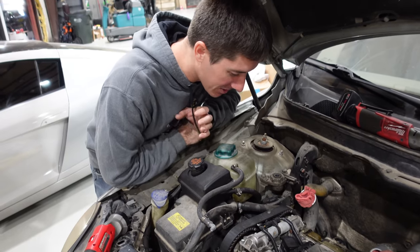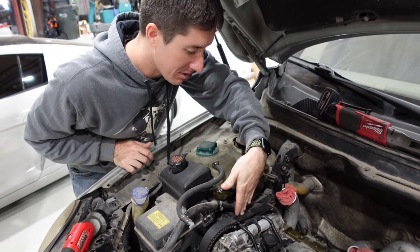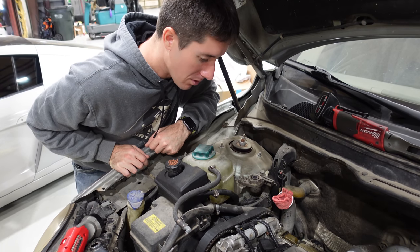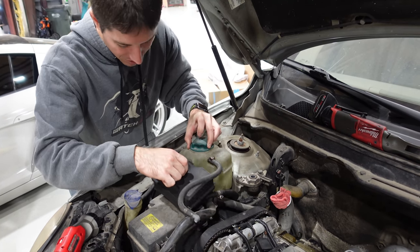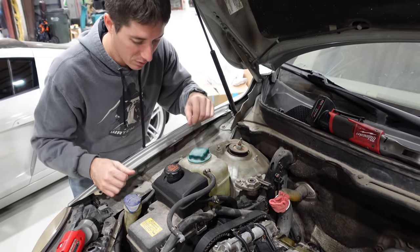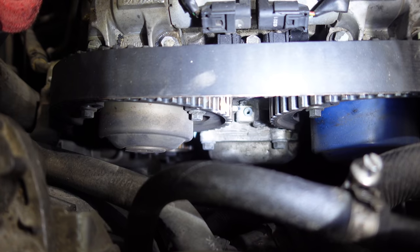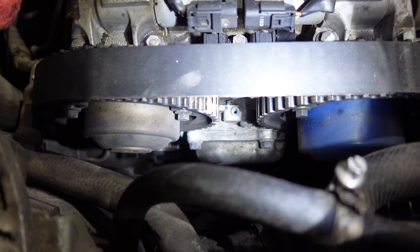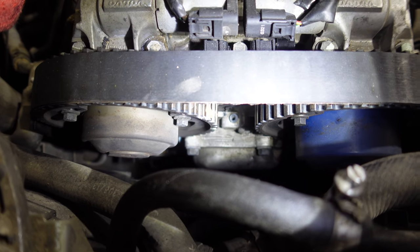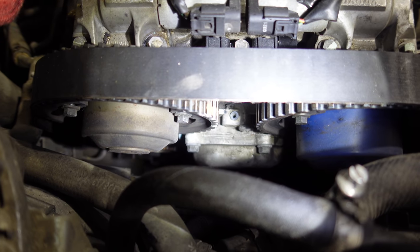It's time to get in here and start shredding this thing. The thermostat housing is straight down underneath the timing belt, timing pulleys, and all that good stuff. So we're going to have to get all of this out of here — power steering reservoir, coolant reservoir. Then we'll be able to access the thermostat housing that's way down inside here. If you look straight down in there where that hole is, that's the broken-off nipple. I figured we'd just go ahead and replace the thermostat housing and everything while we're in here.